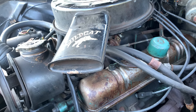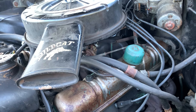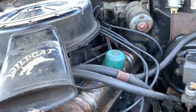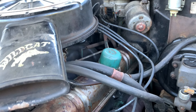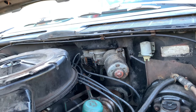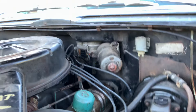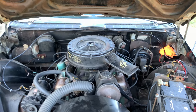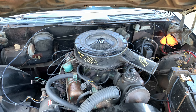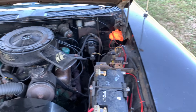All the plugs when I pulled them out looked pretty good and clean — didn't have a lot of oil on them, but the engine does have a little bit of blowby when it's running. It could be normal for a non-PCV engine since it just has the vents coming out of the oil breather caps on both sides and the road draft tube off the valley cover. Maybe that amount of blowby is normal, but it's enough that you can smell it on you after driving all day. Not too keen on that. I also need to get my wipers working — that's next on my list.